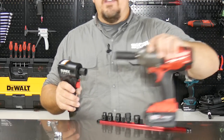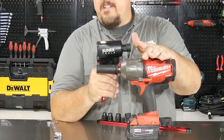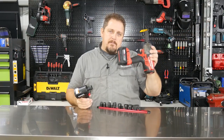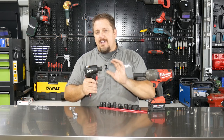Compare that to this tool here, which is a typical cordless impact with a typical impact socket, and there's quite a bit of difference there as you can see. Obviously, this is kind of the big side of the game — this is pretty common for a lot of us to have, whether it's a pneumatic or a cordless like this, where we've got a full-size gun and full-size impact sockets. That's quite a bit of difference in size compared to using a low-profile socket, as you see here.